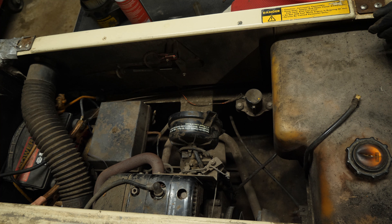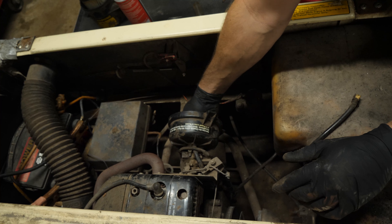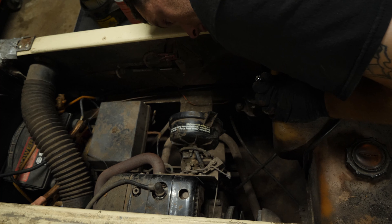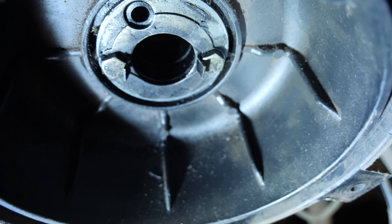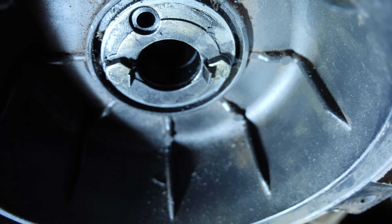You remove that and then you have some 10mm nuts on the inside here. I forgot they have a safety bracket in there. See those little tabs that are over the nuts? You have to basically grab them with the pliers, bend them in towards the center. And then you can get a socket on there. That's what happens when you only work on a certain generation of these things once or twice — you have a tendency of forgetting what is really needed to do a certain job.